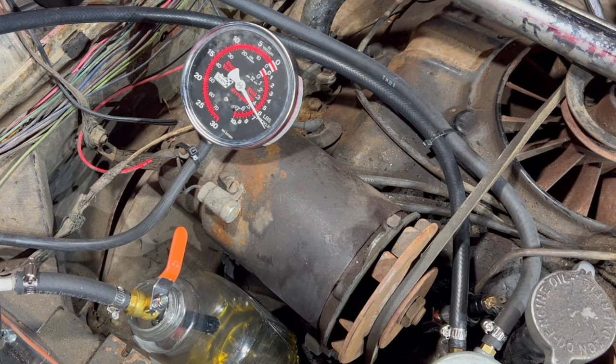Okay, that quickly popped up above 6, and I don't know if that's going to continue and damage the pump, so I'm going to stop there. But clearly this pump is capable of developing at least 5 psi of pressure against a complete restriction. So I think that's a pretty good test. I think there's no reason this pump shouldn't work that I can think of.